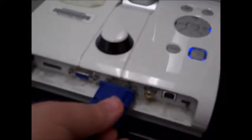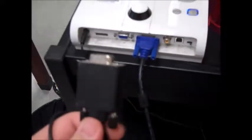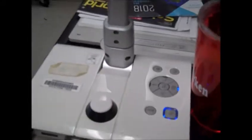You're going to put it in and screw it in. After that is done, you're going to take your other VGA cable. Actually, if you want to use the Elmo this way you need three VGA cables total. If you had an Elmo set up last year through this method with a docking station and a monitor, you should already have three of these cables. This third one is going to go into the back of the projector — screw it into the port that says RGB out, which should have a picture of a projector right below it.